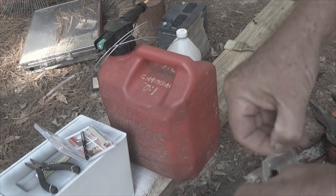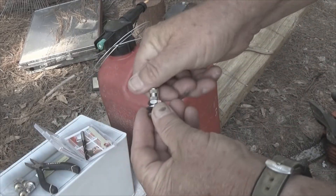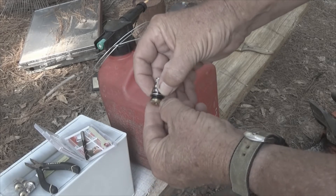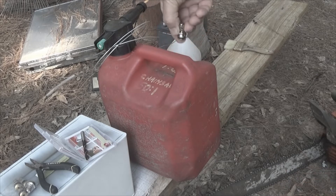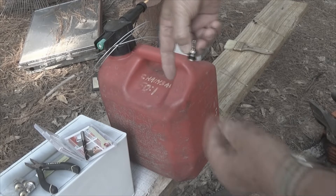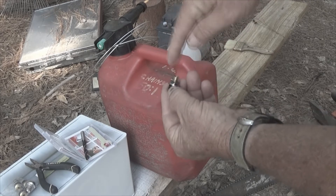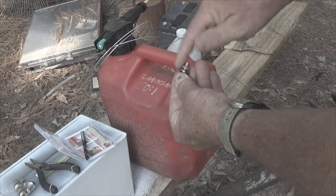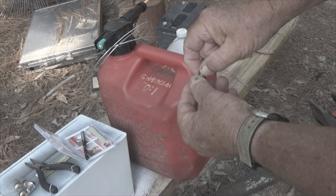Let me show you this real quick. It has a cap, it has a little nut which will tighten up, it's got a plate that's going to push down, then it has two O-rings and then this piece right here. This will be pulled through the tank and up using the wire. Once it has been pulled up and out, these pieces — the O-ring, the clamp, and the nut — have already been threaded onto the wire. We now push the O-ring down, push this down, screw this down, and then carefully holding this, we tighten that up with the little wrench. And then life is good.